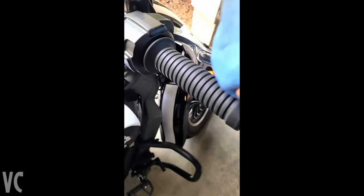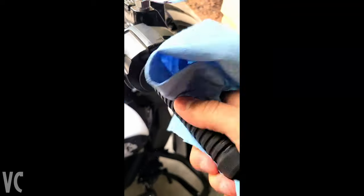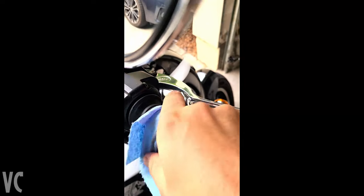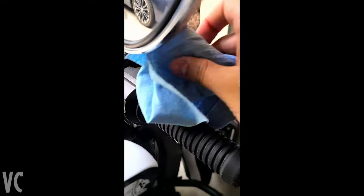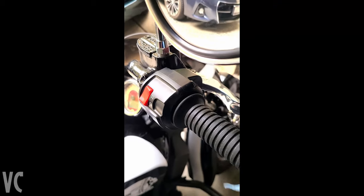What you're going to want to do is clean off the grips. Here I'm just using the cleaner I have on hand, spraying it onto the shop towel and wiping down the grips. This is to make sure that you get off any residual grime, dirt, grease — anything that you'll typically pick up while you ride. You want to make sure you get all of that off and have a clean surface before you try to stick on the new grips. You obviously don't want to stick it on dirt and grease as it's not going to stick very well long term.